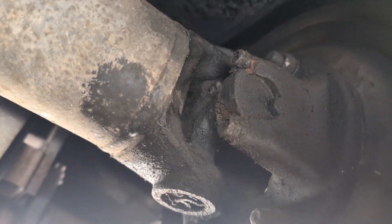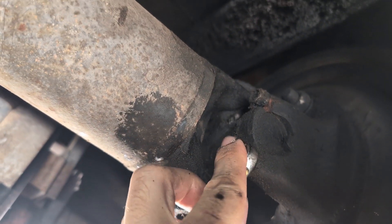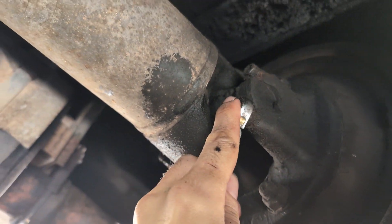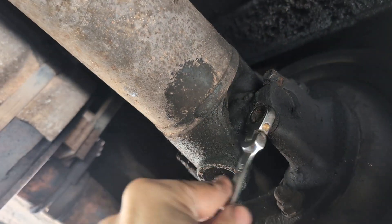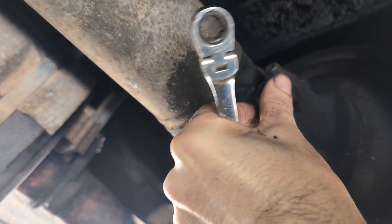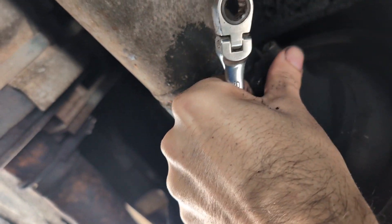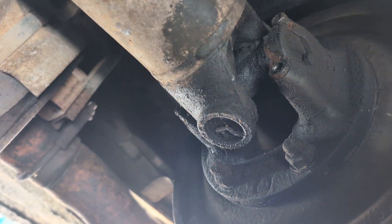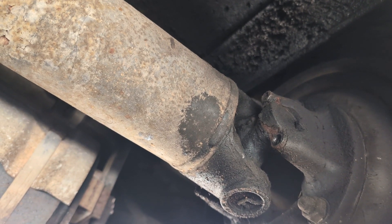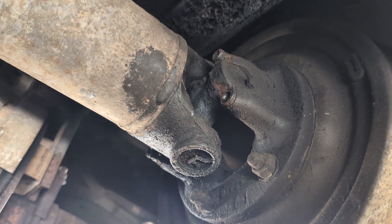So I did some peeking — you've got four driveshaft bolts, had to dig them out. These are 7/16ths and they're in tight spots. I'm using my flexi-wrench here. When you get them out, there's a cap that comes out. Keep your head clear when you get the last one out because the drive shaft is going to move around. You don't want it in neutral — you want it in some kind of drive gear so that you can get some tension and pop it loose.